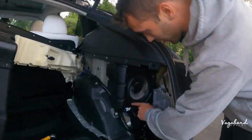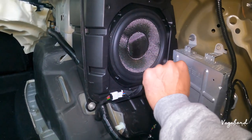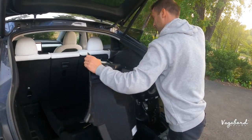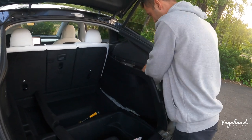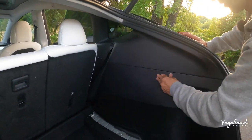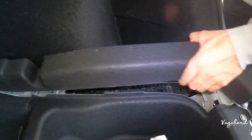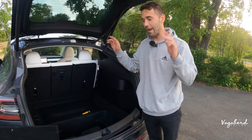Subwoofer is completely installed — the four Torx 20 screws dropped in. I made sure to tuck away that extra pigtail that the Light Harmonic subwoofer comes with to make it a cleaner job — it's all secured. Now what we're going to do is put back the panels the way we took them off. Make sure your clips are in, all those little white pieces — slide that in just like that. Make sure everything lines up before you start forcing plastics and all that stuff, and this should just clip in real nice. If you're fighting it, you're not doing something right — so don't break anything. After we're done with that, we're going to drop everything back in. Let's go ahead and shoot over and do a sound test with everything installed.